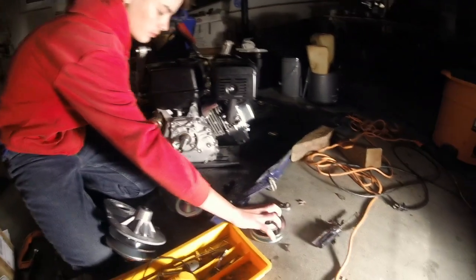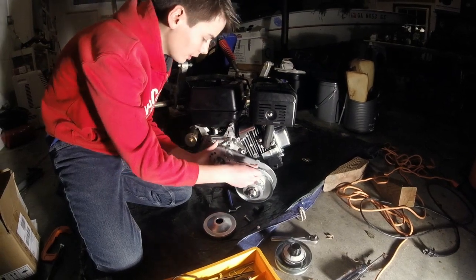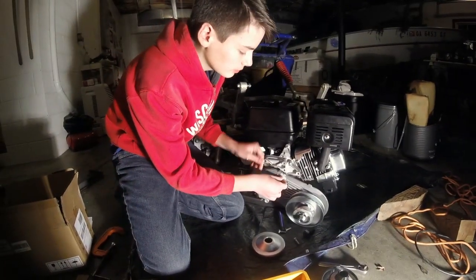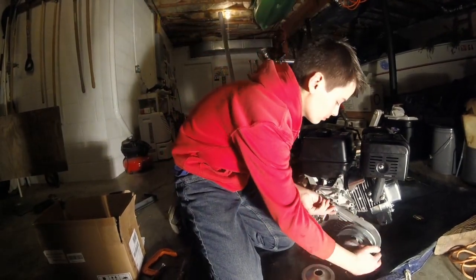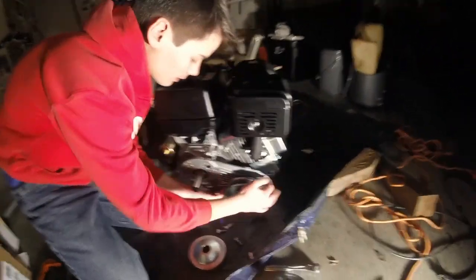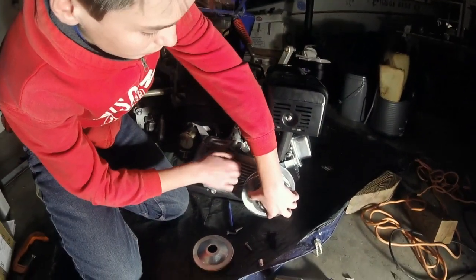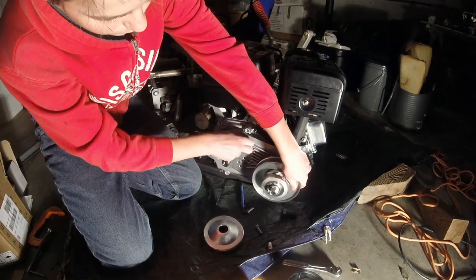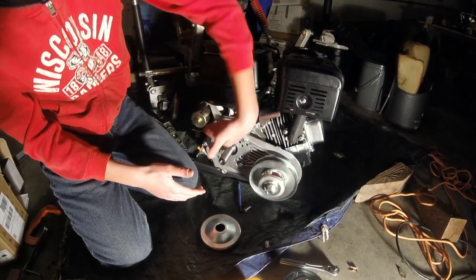To install it, you're going to place the driver pulley on the engine and line your bolt holes up however you'd like — there are six holes here. If you're installing this on a 420, you're going to have to buy bolts because the ones that come with the kit will not fit. Check your instruction manual for the size — these are just grade 5 bolts I got at ACE, only about a buck each. Depending on your configuration, you can also orient it facing different directions or even backwards.